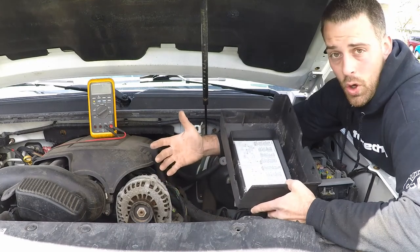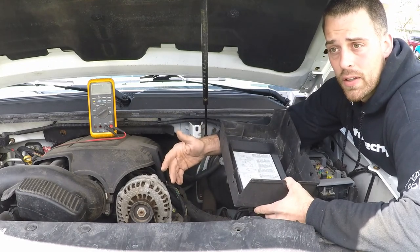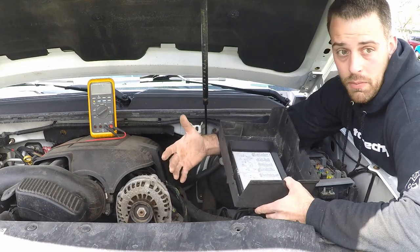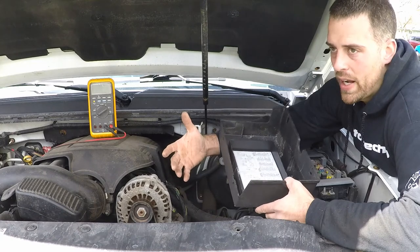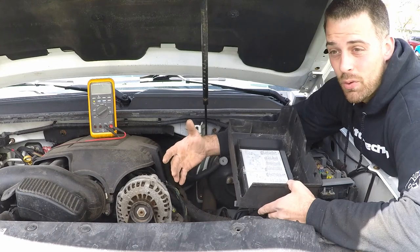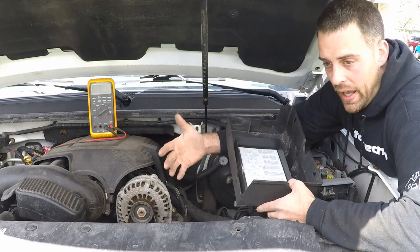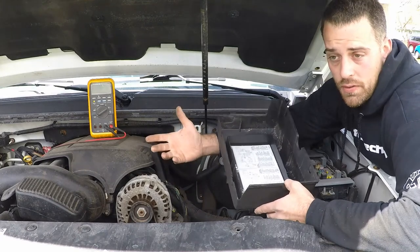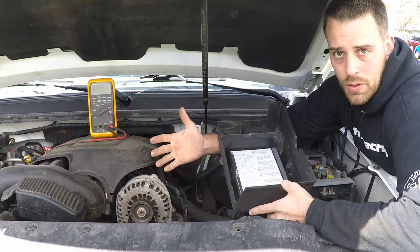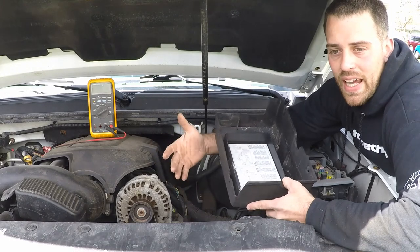So most small cars, like my Saturn over there, I think that's an 80 amp output alternator. And so when we talk about beefing up the system, that might mean running a bigger alternator. That might mean that you have to get some sort of adapter or bracket system to be able to handle a bigger alternator that's not meant for that vehicle. It might even mean running dual alternators and doubling your battery size so you can handle those huge power draws, hundreds of amps at a time, in order to operate that system. Now, we're talking pretty extreme systems, but it seems like most people are interested in the extreme, not the mundane.